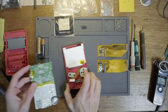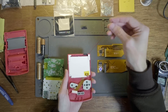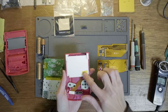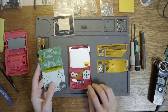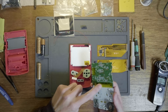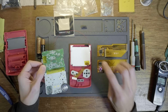This is pretty much what you get when you order a kit. I've already installed the screen, the power LED is already connected, and there's a screw bracket installed with the buttons in. I've taped off the connectors on the screen because we won't need access to those. One of the easiest things to forget — and I get a lot of questions about this — is to mask off these areas here because they're pointy and press right into the ribbons and damage them.